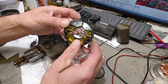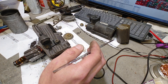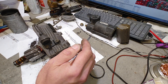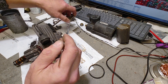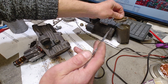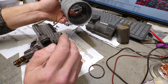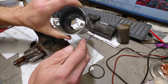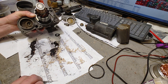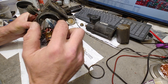The brushes look good - very nice, no problems here. This other area is the intermediate plate for the moisture filter. The actual magnet assembly here is good, no damages in the magnet assembly, although there's lots of residue. The dust and all of this stuff came from the motor. This bearing is okay.